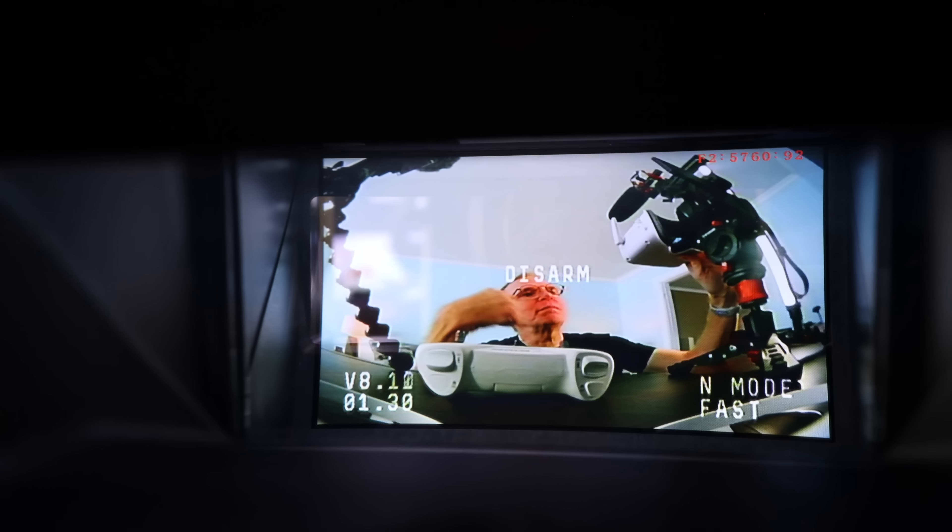Back on my couch in the living room — I'm going to power on the goggles and drone for an indoor flight to show you the other modes. The controller is already on. Attach the battery and everything should connect to the goggles and radio. If the light keeps flashing and it won't connect, move the left joystick up and down or hit the arm switch in and out and they should eventually connect. I'm looking inside my goggles and I can see everything. I'll hit the red record button — I heard a double beep, so it's recording.